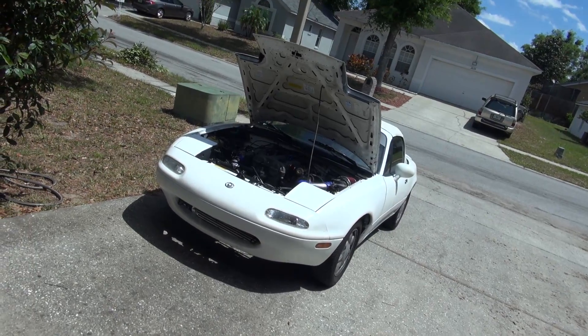For installation I'm giving them a C. Although everything kind of fit together, there were some minor hiccups to jump through, and with no instructions whatsoever this is not for someone who needs their car up and running in two days. You need a solid week to work out bugs, deal with problems, and make runs to the hardware store. You'll need tools — I needed snap ring pliers, a drill bit for the oil pan, and a tap and die set.